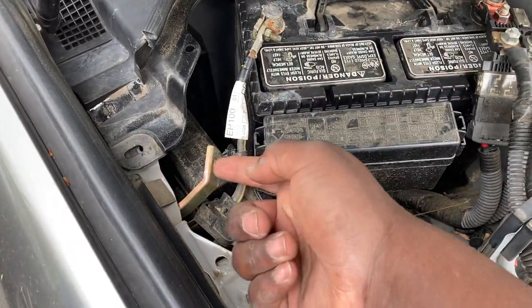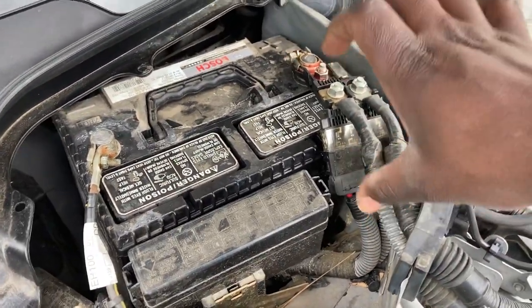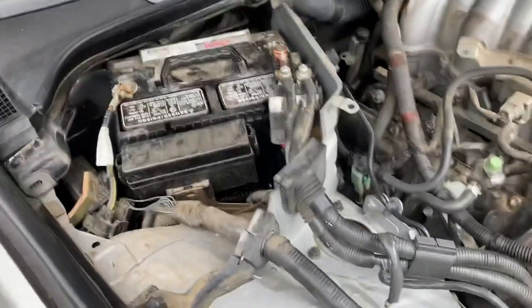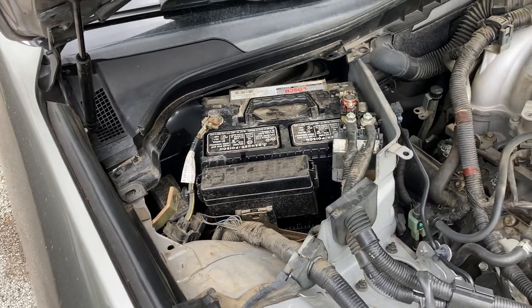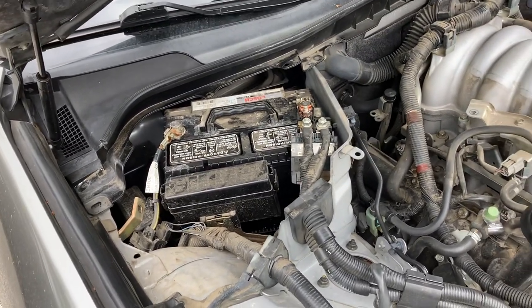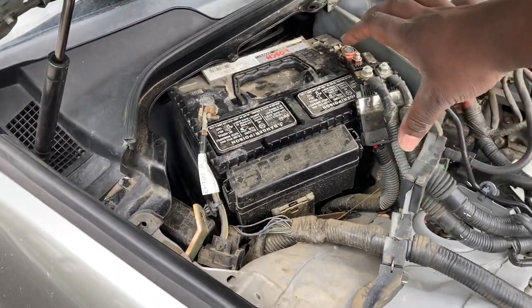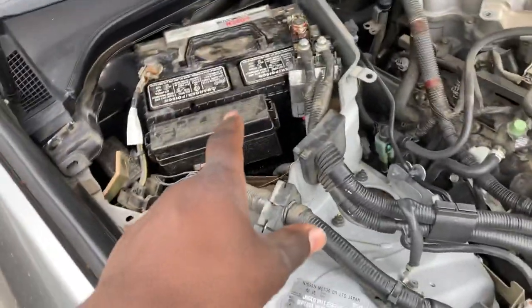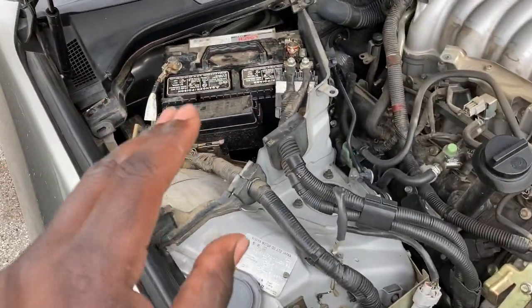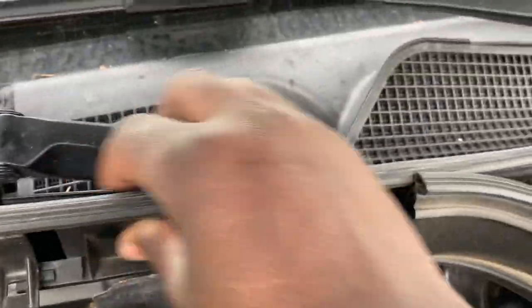The terminals are in the middle of this battery, but they're supposed to be off to the side so the bracket can attach properly and the cable doesn't have to be removed. I also noticed the terminal had been bent — straightened out — when it's supposed to hang over the edge at 90 degrees. The plan is to get the right battery sorted out, possibly swap in one I have in mind. We don't want to bend it again and have it break before a three-and-a-half-hour trip home. It's working right now, so best to leave it.